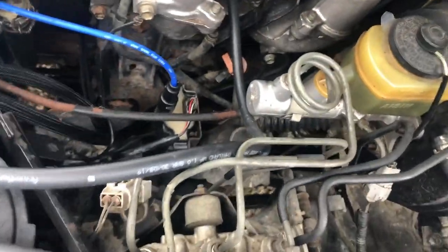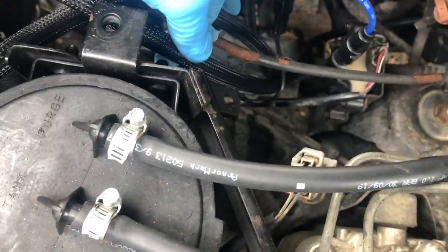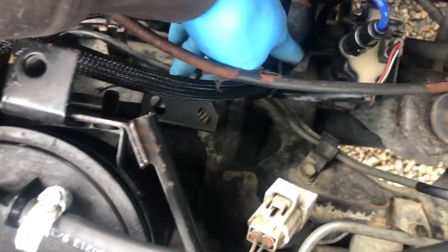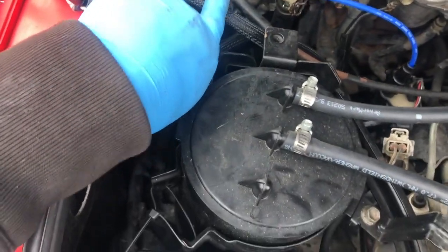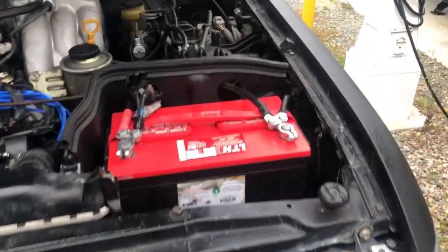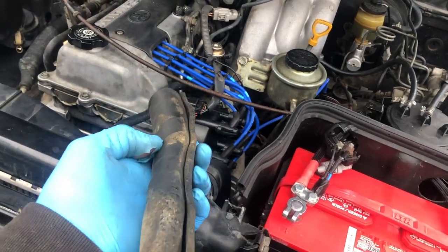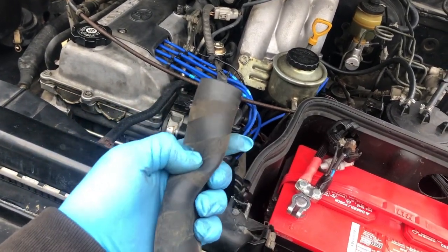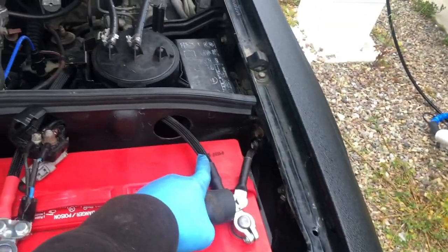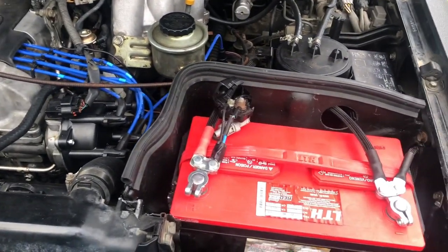For the future, I might look at maybe putting some rubber or plastic loom in certain places. Not because I'm afraid these wires are melting, but I can already see down here how it's against that metal. And with movement, that's going to eventually rub all of this off and it could rub through. I mean, that would take years and years, but if I just put a little piece of plastic loom, which I have more, I think, in my solar stuff, or maybe reuse something like this, like wash it up and just wrap it with a little bit of electrical tape. That way when it rubs, it's gonna be rubbing against something like this versus this. Like I said, I foresee this lasting a long time, but I like to take extra precautions.